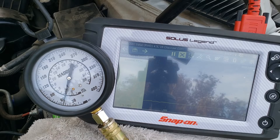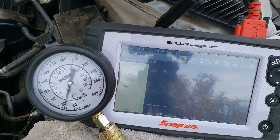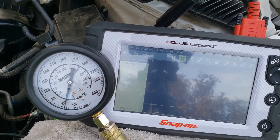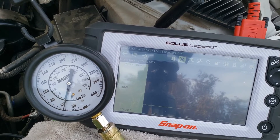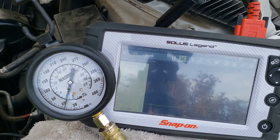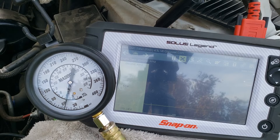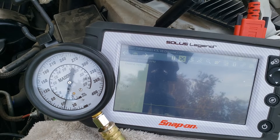We'll begin with a quick test. The vehicle is idling in park and the engine is at operating temperature. The scanner is only used to monitor engine RPMs for the quick test. We are getting about 55 PSI line pressure in park. The specification is between 55 PSI and 189 PSI on drive, park, or neutral. I shifted to neutral — same reading. Shifted to drive — same reading.